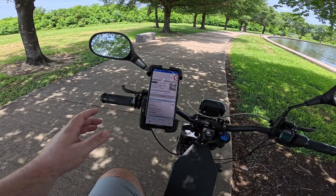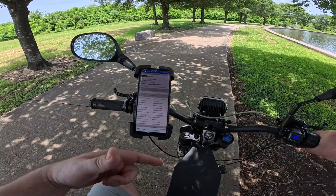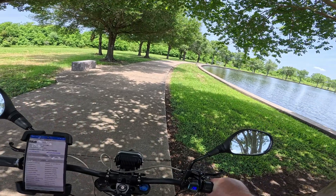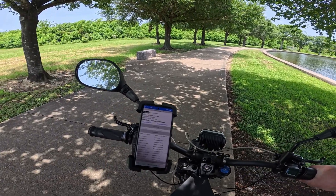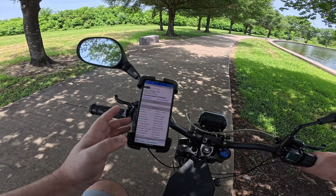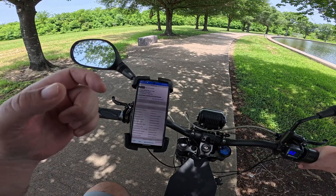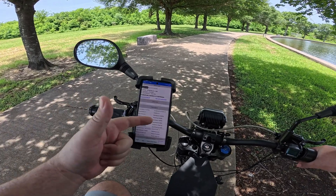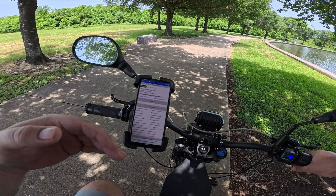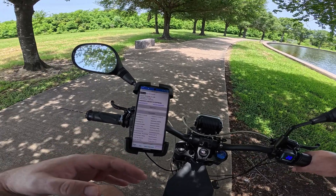So I fed it my controller, my motor, and everything, and asked where I could improve. Basically it says with the QS273 2.5T that I'm running, my FarDriver controller can handle up to 660 phase amps. I'm currently running 480 phase amps, which is three times the max line current I have set to 160. It said I should be able to run 660 phase amps and still be safe, because the QS 273 motors are designed to handle large quantities of phase amps.